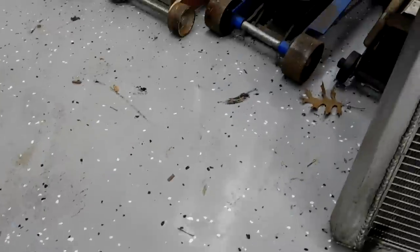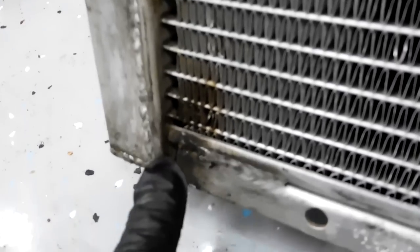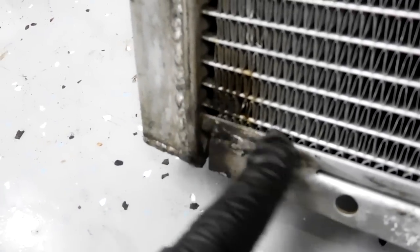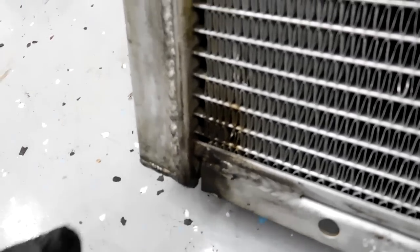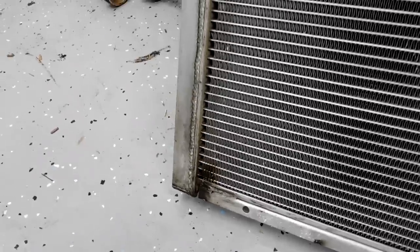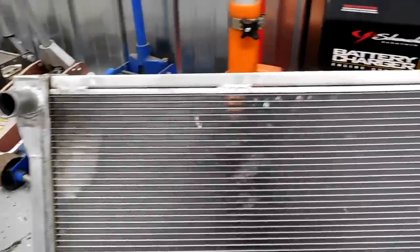Remember, this is not an old radiator — it's a fairly new one. You can see leakage up here at the top of the tank and a little more down here. It didn't leak a lot, but it leaked when pressurized — you can see the wetness. Eventually all the coolant will leak out, and something like this should last longer than a year.